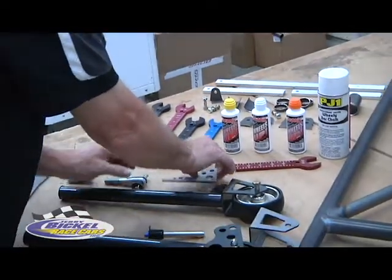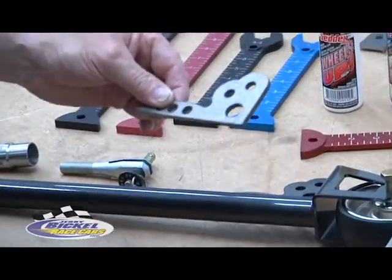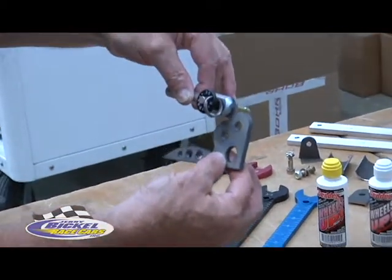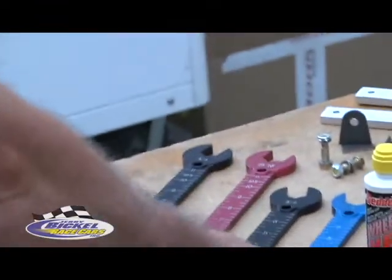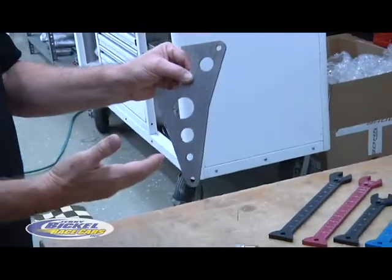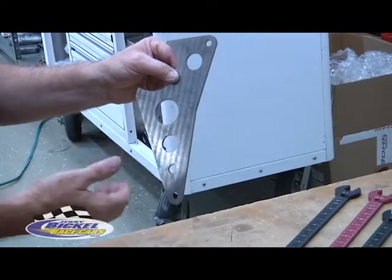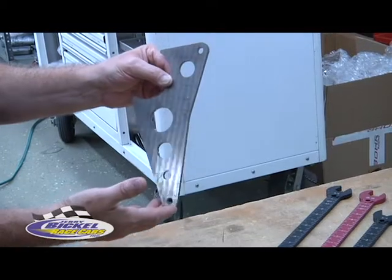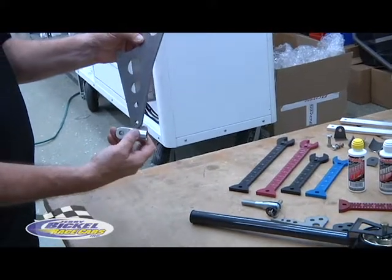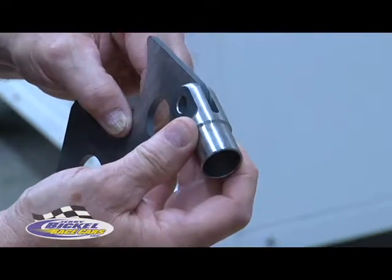This particular wheelie bar uses a different design gusset to the back of the caster. Instead of using a rod end, we utilize a clevis and a pin to slide over this pickup point. The rear axle housing gets a bracket like this that welds to, which makes it very popular for 12 bolt applications, 8 3/4, Danas, different housings other than sheet metal and fabricated 9-inch Fords. And then the upper and lower bar are connected, instead of a rod end between a double shear, they're connected with a clevis sliding over the bracket.